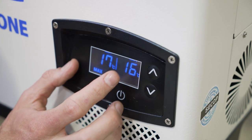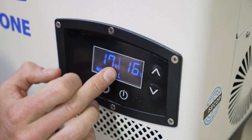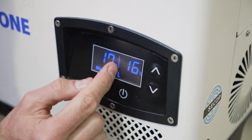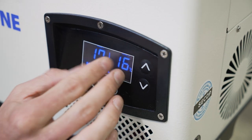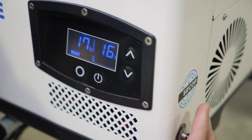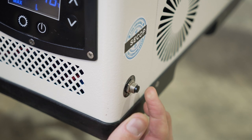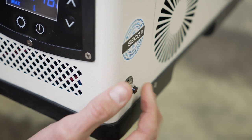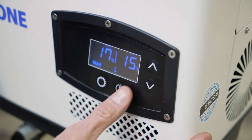The control panel is really simple to use. It shows the fridge is on and operating fine. Error codes can come up if there's an issue — the user manual tells you what they mean. If you get no power when you turn it on, check the circuit breaker on the end; if it's popped out, just push it back in — it's just a safety mechanism. There are also a lot of parts you can replace; just contact Evercool and they can arrange spare parts.